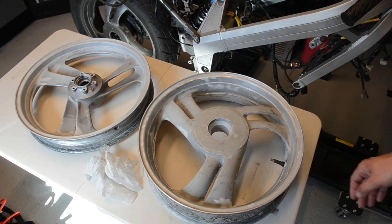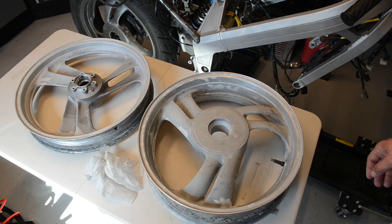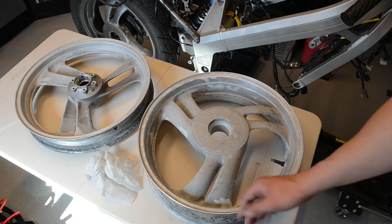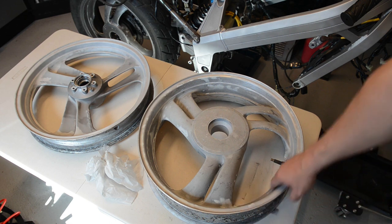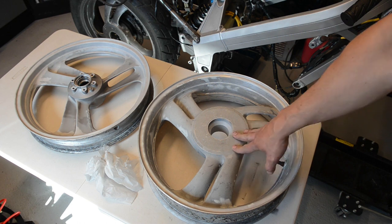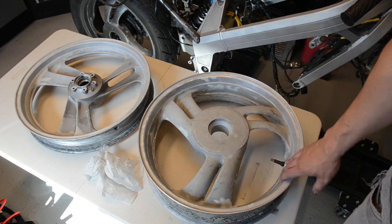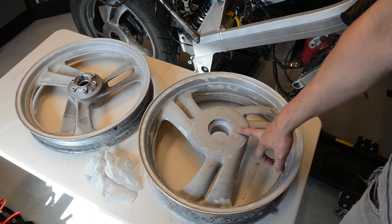As you can see, I've shot them in the cabinet so most of the paint is off. There are little bits left but they're nice and flat so they won't bother me. One thing you'll always notice about these wheels is they never have any balancing weights on them. That's because most balancing machines can't balance these wheels — they have a single straight arm so you need a special adapter, which most shops don't have. I have two wheels here and neither has weights, so either they're 100% perfect and straight, which I doubt.